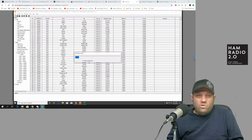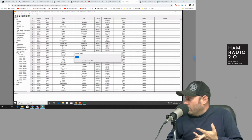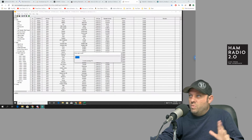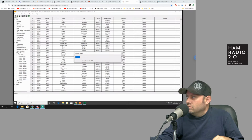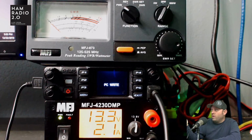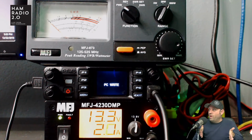But again, just wait. Don't disconnect it. Don't power your radio down. Make sure everything's where you want it to be, and just be patient with it, because you don't want to hose up anything. You don't want to brick the radio.